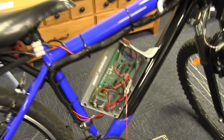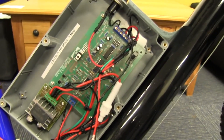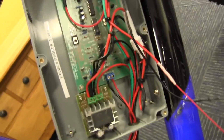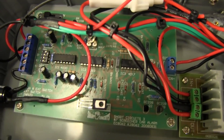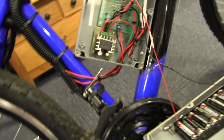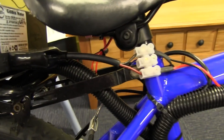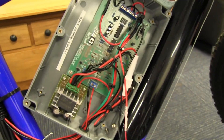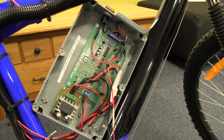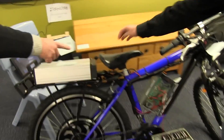The wires come in the other side and are cable-tied up to the frame. In the middle of the frame he's built a burglar alarm — an anti-theft alarm for the pushbike — built up from a project kit. You can see the double-A batteries there to power it when the bike's not being powered by the main pack. There's a tilt switch on the back of the battery pack — a mercury switch — so if the bike is tilted, the switch is in the off position. Stand it up and the mercury rolls to the other end and closes a circuit.